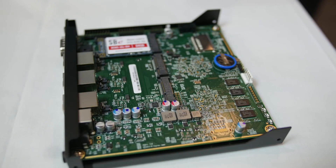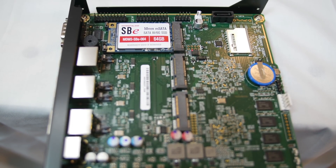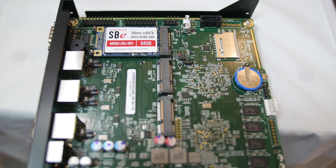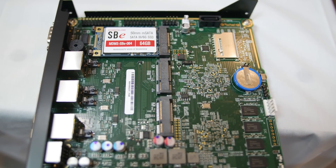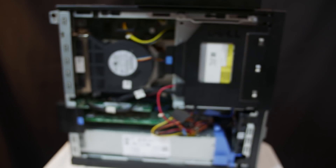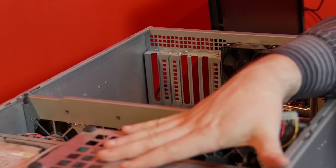PFSense has a ton of flexibility and a ton of features, and the PFSense team has done an amazing job with the software. You can actually buy physical hardware routers directly from them to support the project - those are the really nice Alix small form factor machines, six-inch square, an inch thick, based on the AMD APU. They have three network adapters - LAN, WAN, and OPT1 - with three mini PCI Express connections internally and the whole platform is very low power but full x86. You don't have to use a small form factor computer - you can use a full desktop computer, a motherboard on a desk, or an old server with error-correcting memory.